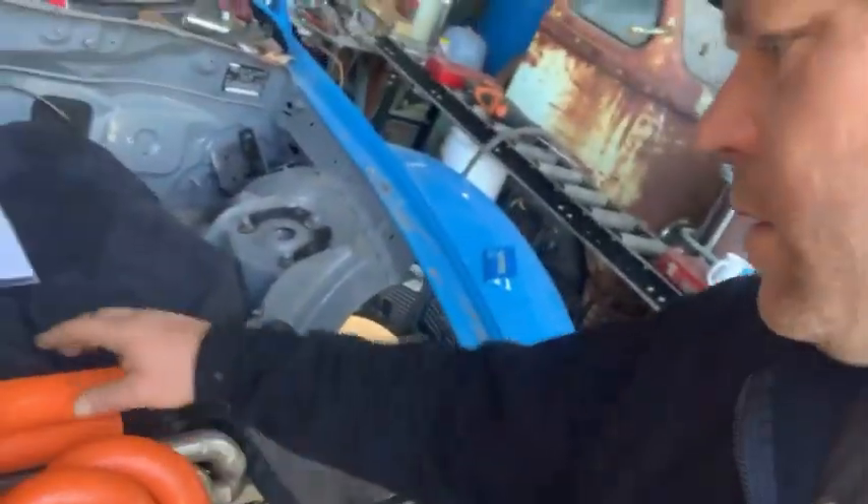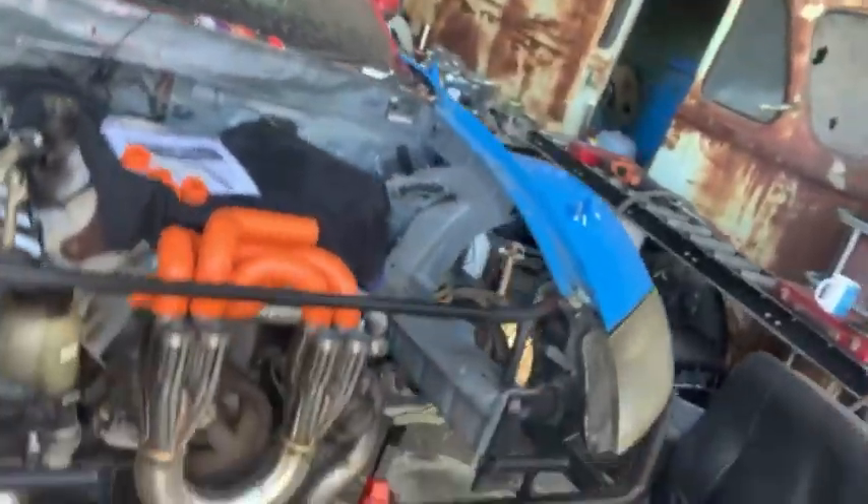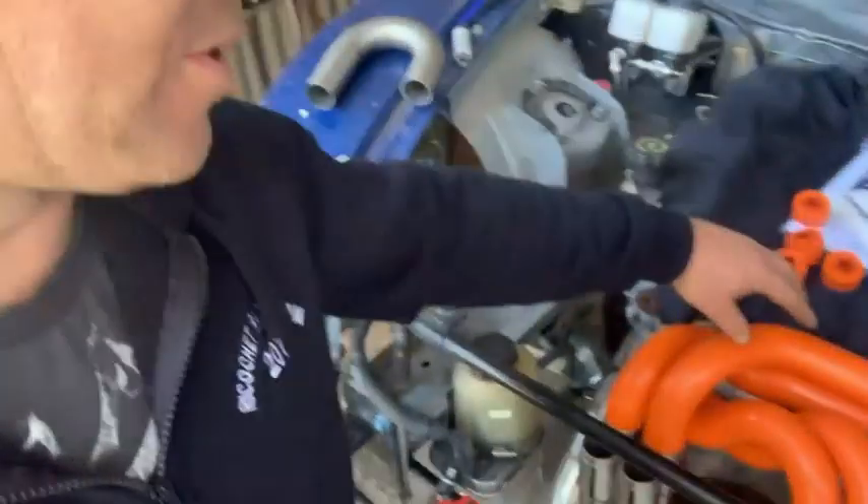It's a good system. I've seen it years and years ago and thought I'd love to have that, but I've never actually built a set of headers so I never had any reason to buy one. Started this project and thought I'd try to make a bit of a different exhaust system, and it gave me an excuse to buy one. Pretty happy with how that's come up. You need two to go over the top and two to go underneath, otherwise you'll never be able to get your headers apart. You need to make them so one side goes over the top of the other so you can pull that side off, get the other side off, and it's all happy days. Now we'll move on to doing this side.